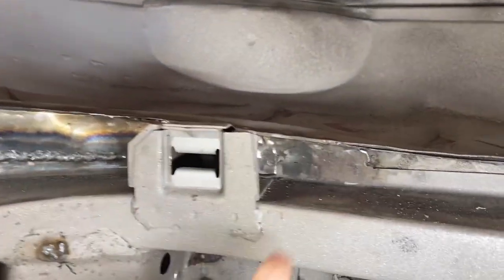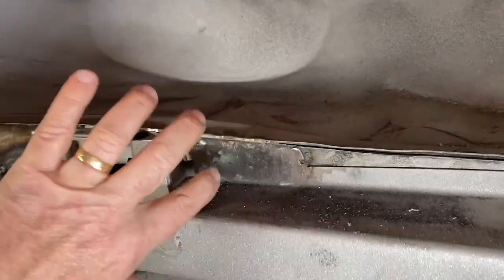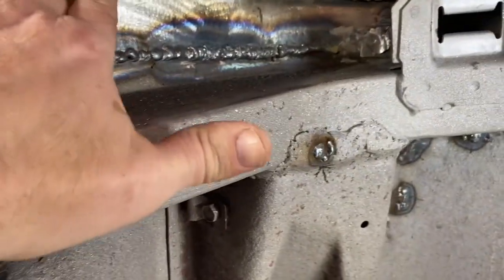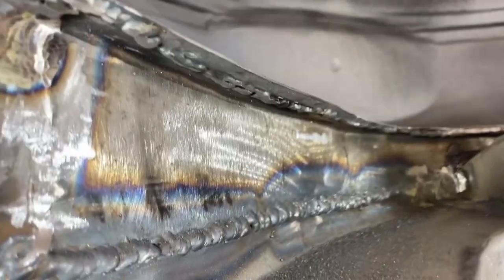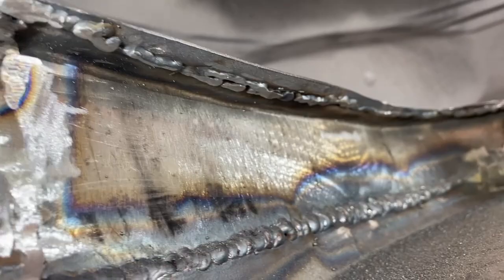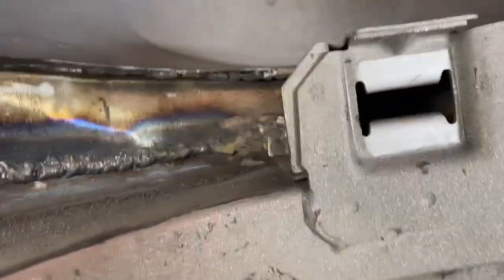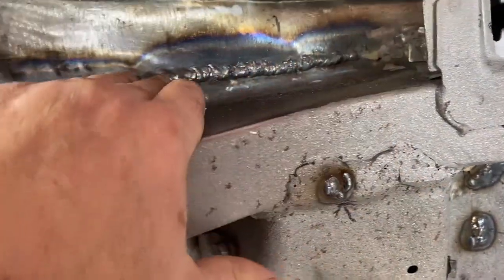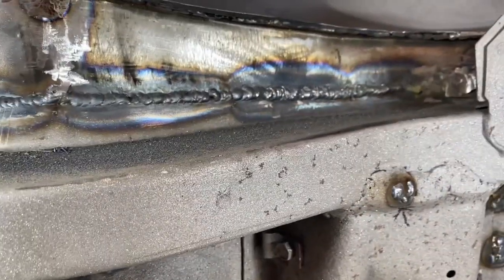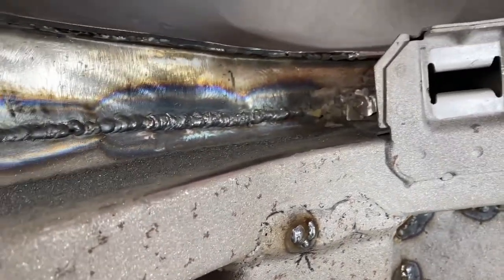And the grinding is done. This side came out pretty nice — you can see where the edge of the patch is. Neighbor just fired up his motorcycle. Sounds nice. Underside of this is cleaned up pretty well. You know, you won't be able to tell if you look inside the wheel well. If you crawl underneath, you'll be able to see that that's tack — or kind of a patch — stitch welded all the way along. Almost nobody will ever see that. And I think I might just leave this joint welded. Anybody with a trained eye is going to see it — that's a patch — but it's in strongly.